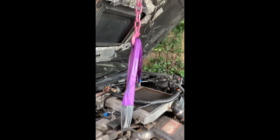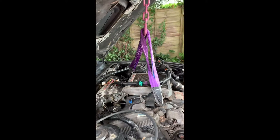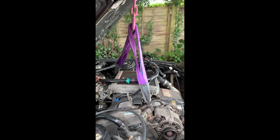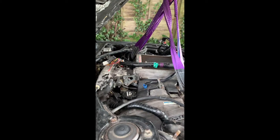Now that we've got the crane on, the bonnet's up as far as we can go. Hopefully I don't need to take off the bonnet. You can see the crane. I've actually jacked the car up again further, as high as I could on axle stands. Pretty much everything's clear in the engine bay, and we've got this weight-approved strop, so this is strong enough — it's load-approved.